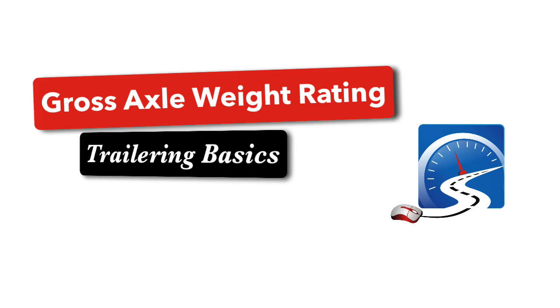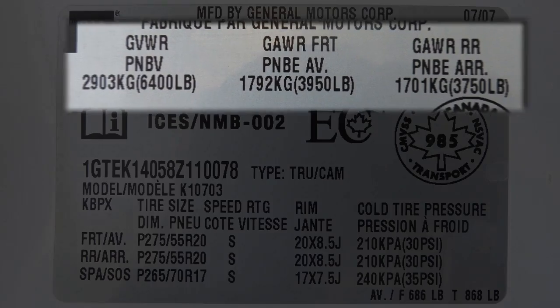The last piece is axle weights. If you have a tandem axle trailer, those two axles together count as one. You have the front and rear axles on the towing unit as well, and you cannot exceed those axle weights — they're listed on the door sticker and in the owner's manual. If you're unsure, go to the dealership for either the towing unit or the trailer to ask about your gross axle weight ratings.